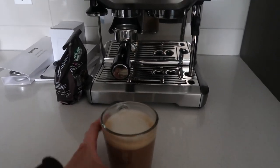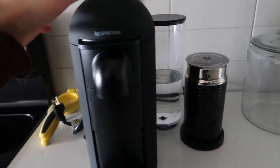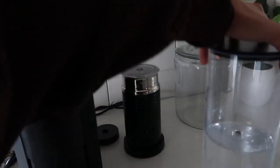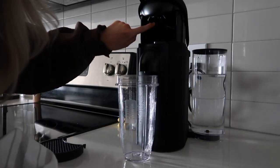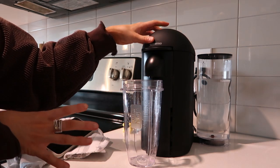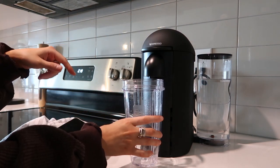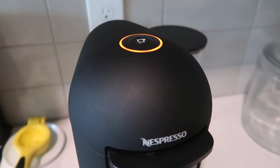This is my first cup of coffee or latte with the Breville. I used my Nespresso machine for the last time this morning because I hadn't yet set up the Breville, but I just set it up. So now I'm going to clean the Nespresso and show you what happens. Make sure there's no pod in the top and the water tank is at least more than halfway full. Put a big cup underneath, then press the top button three times — it will flash orange and go into cleaning mode.